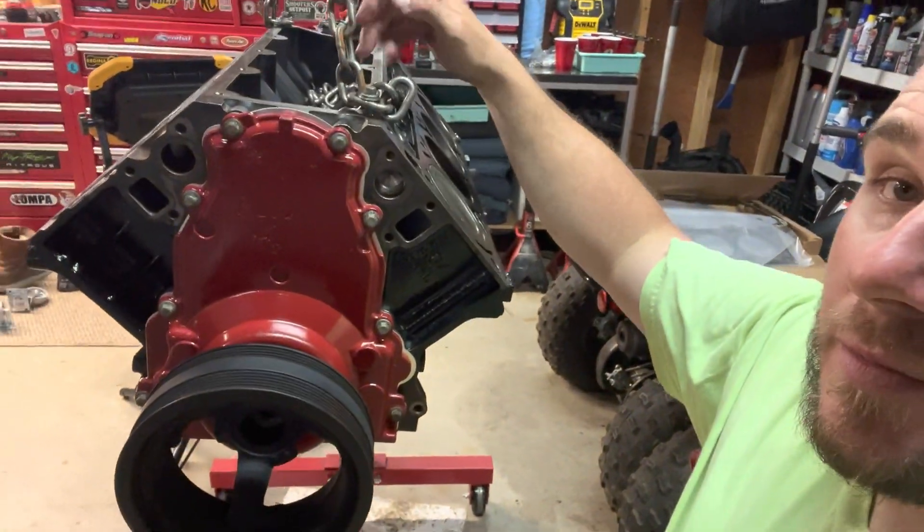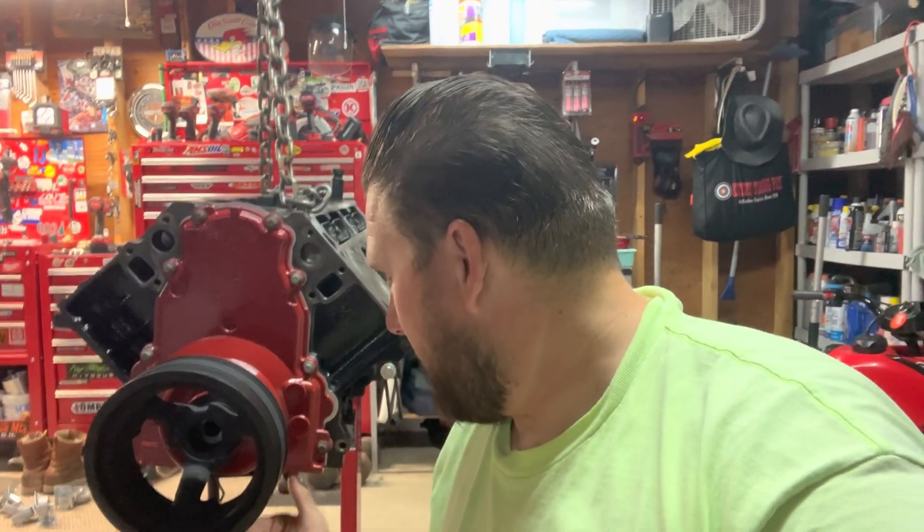Alright guys, that's it for today's video. Rear main seal - rear main seal is put in place. New gasket on the cover, cover is clean, torqued down to 18 foot pounds. You can see she's hanging from the chain still - I got to get one of those engine mounts here to pick this up when I set it in the vehicle. The reason why I did it this way is because I wanted to do the oil pan, like I said earlier, so I had to do that step before I did this step. That's done. I hope you guys enjoyed the video, hope it was educational. Leave a comment down below, make sure you hit the notifications bell so you can keep up on this series of doing the motor. And if you like this video and this type of content, make sure you hit the subscribe button. We'll see you guys on the next video. Peace.